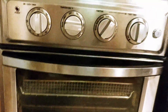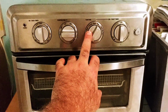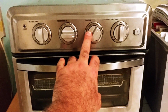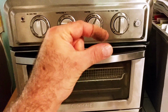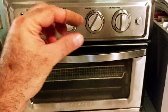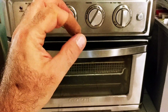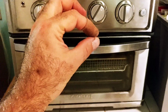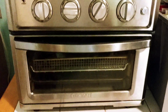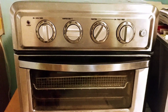If you're thinking about doing this repair yourself, something you should note is 3 of the wires on the back of this switch are soldered into place. So they use the little push type connectors. There's a blade that sticks out, and then this other piece that slides over the blade, and then the wires attached to that piece. So you just pull it off and then put it on the new one. But 3 of those have been soldered into place. So if you're not a big solder fan, that's something to take into consideration.